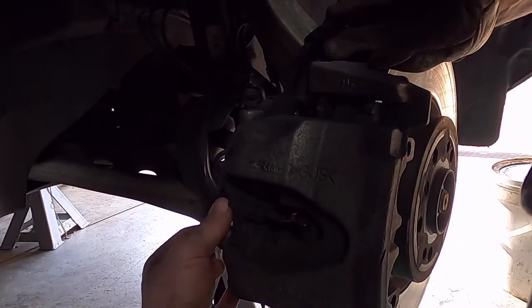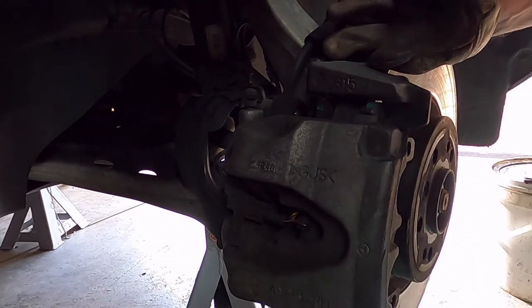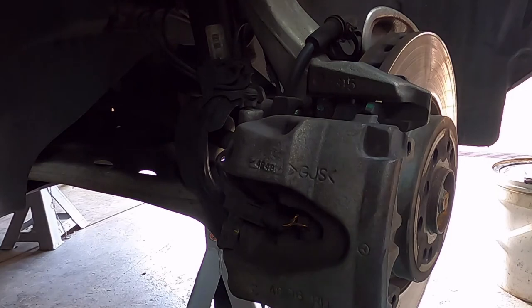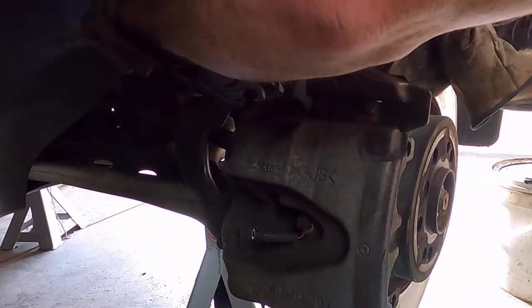Okay, I'm well into this one just because I want to get finished for the day. So this little bolt is a Torx 8, but you can use an 8mm spanner. I do have the proper Torx drivers. That gets the sensor wire off, the sensor connector. Just pull that connector out. It's just a straight pull. And that should tuck out of the way then, so you don't get that damaged.